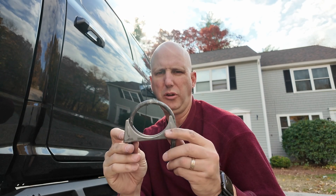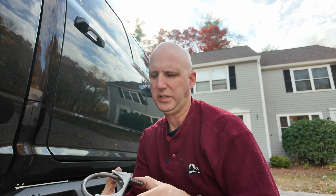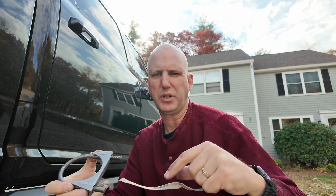Now we're going to bond the exhaust to the body. I am using these new exhaust brackets and I'm going to attach the braided strap to one side like so, fix it with the nut, and then the other side of the strap is just going to get bonded to the frame. I'm going to grind all that stuff off and get that mounted.